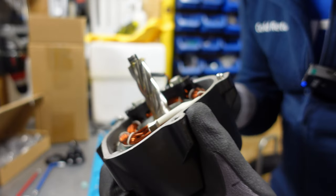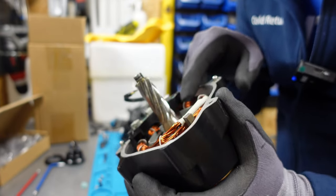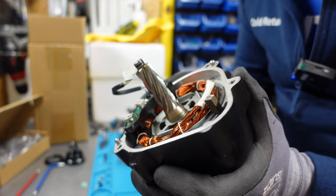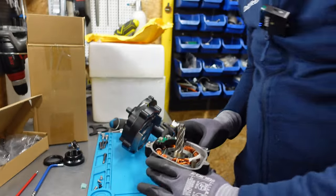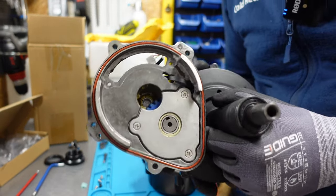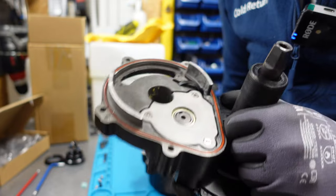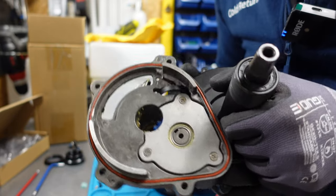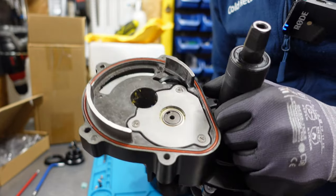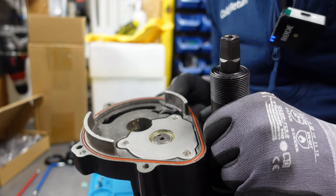You can see the interface for the hall sensors and phase lines, with the hall sensors exposed on this plastic plate — there are three of them, as usual. Here is the gearbox interface. The famous blue gear — I see it again. It's behind this plate, so it's possible to replace it if it gets damaged. Here you can see the cable going to the torque sensor.